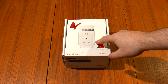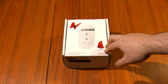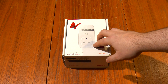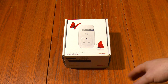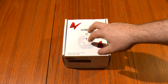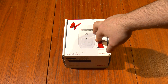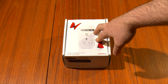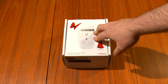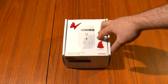It's quite a short range — I think it's only about 10 metres. I think it'll support either up to four or up to eight calls at once, and you can register up to 32 phones to it, because it won't just act as a cell for anyone passing by — it's a cell just for the phones that are registered against it. Although it is 3G, I don't think you'd want to use it for data, just in case they happen to charge you for using data on your own broadband when you've got Wi-Fi available. But for making calls, at least, it'll be better than having no bars at all on your phone.